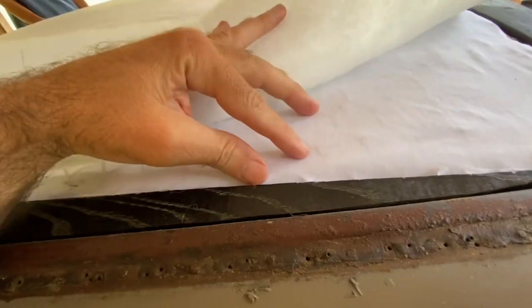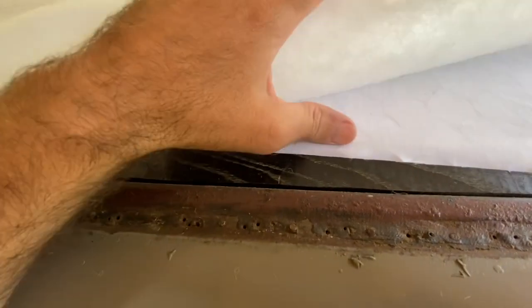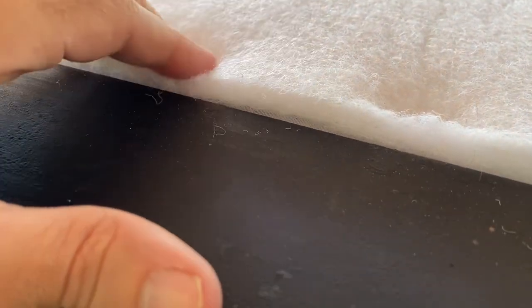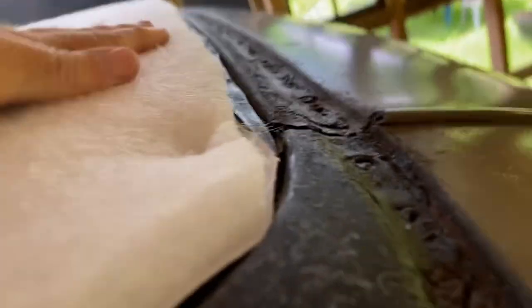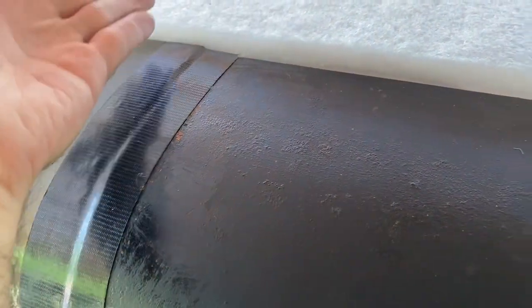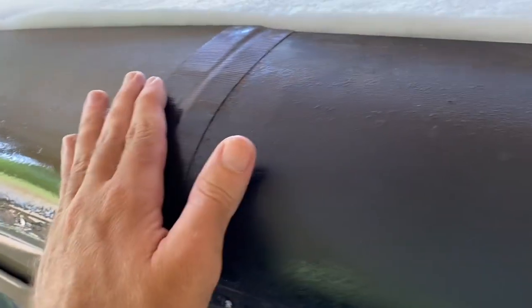On the back here, I don't want it to be exactly the same as the cotton sheet. I want to feather it out and maybe come about halfway up this header here. I've gone around and put a few staples — one in the corners — to hold the padding down and make sure when compressed it fits down within this groove. Along the back, I split the rear header with my cut right there and kind of rolled it around the edge. This seam was very high on one side and very low here. I went inside and added a few washers to build this side up. Once you put the Gorilla Tape over it, and by the time we put that blanket over it and then the top material, we're going to hope and pray that will hide almost all of that entirely.